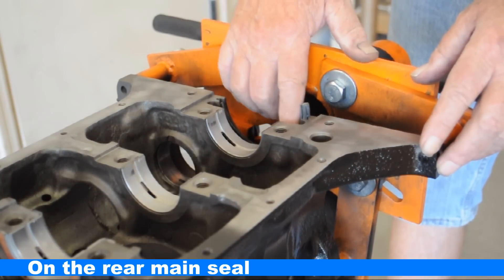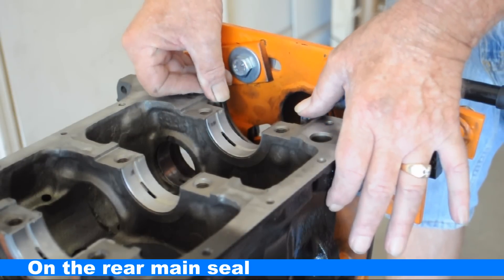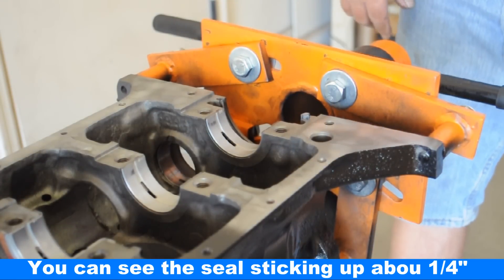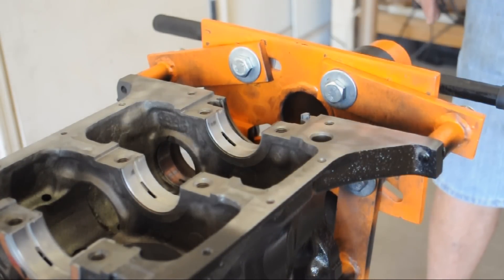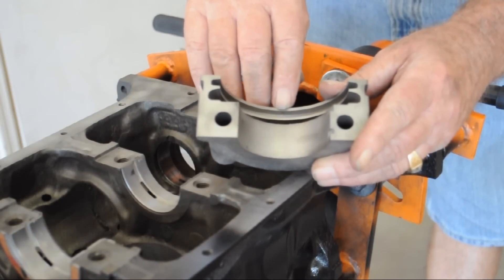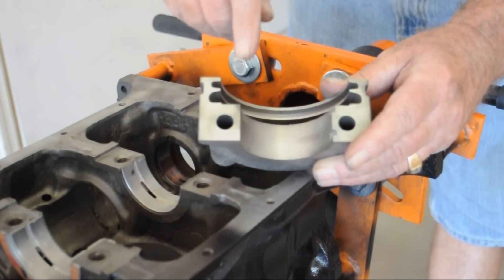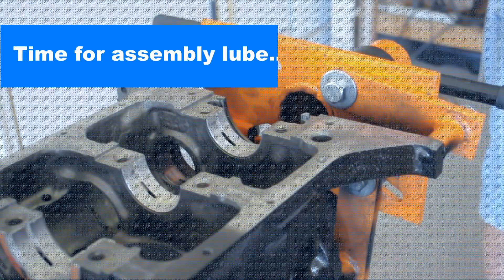You put the lip seal in with the fat part of the seal towards the motor, and then down just a hair in rotation. I don't like to let the ends butt against each other — I'd rather have it meet up in the cap, just a little bit. This is from experience. Also, you always have to make sure that in the main cap, down where the lip seal goes, there's a pin that comes through to hold the rope seal where it belongs so it won't rotate. You have to take it out, otherwise it'll crush the lip seal and you've got yourself an oil leak.